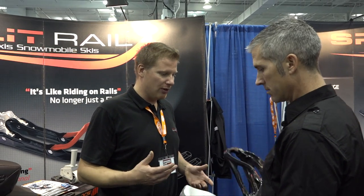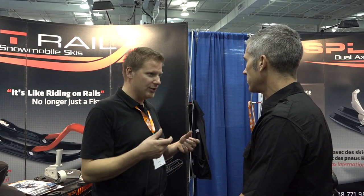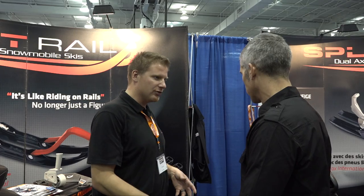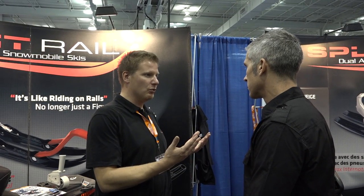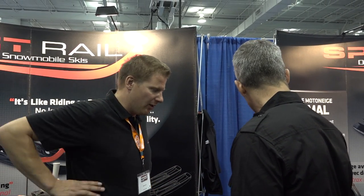How would this work in the powder? It's a good question — we get asked that a lot. It really depends on the sled setup. If you have a sled set up to go on and off trail, running a bit bigger track like an inch and a half and up, because it has no keel it's got no drag. And because we have that slight tunnel design on the rails, it actually cleans up the ski really quickly. As soon as you start trying to carve in the powder, the ski wants to go where it's pointed, so it actually pulls the front of the sled up. Your line gets really tight and really accurate — it's a lot of fun to carve in the powder because you start doing lines you've never done before. It actually works quite well off trail.